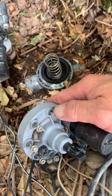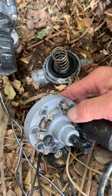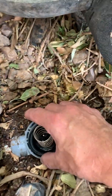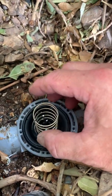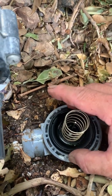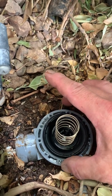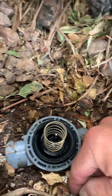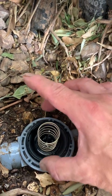Actually there are four tricks. Third trick: use the nut driver. It's so much easier to remove and install the bolts using a nut driver. Fourth trick: install the diaphragm into the base with the pin and the spring on top of it, so that when you place the cover down onto the whole assembly you don't end up pinching the diaphragm between the top and the base. I've messed up three of these diaphragms already simply by not putting the diaphragm on first and then gently centering things.